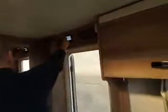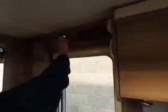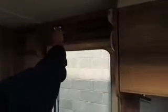We'll just run across the top line. That's not gas. Everyone thinks it is, but it's just an icon to say the heating's on. The next one, which is flashing at the moment, is the water heating, which is showing 60 degrees. The reason it's flashing is it's not up to that temperature yet. It will flash until it gets up to temperature, then it goes solid like that. Same with the heating: if the heating isn't up to temperature, that will be flashing.